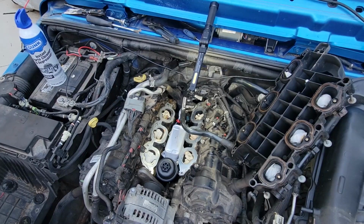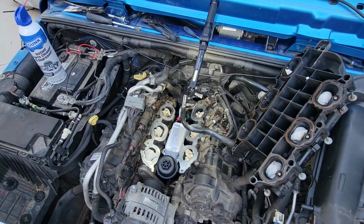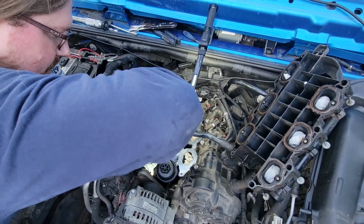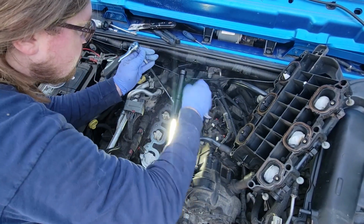So the bolts themselves go to 35 inch-pounds, and that torque spec will be in the description. It does not specify a torquing sequence. 35 inch-pounds. So I'm going to torque these down. I'm going to go like every other one.